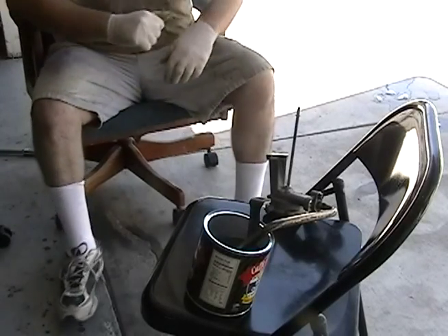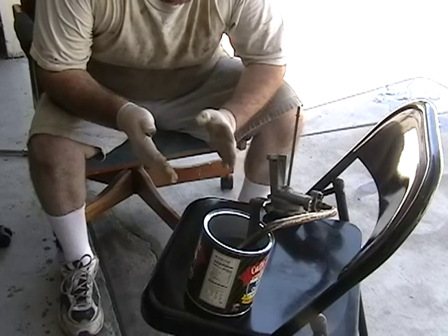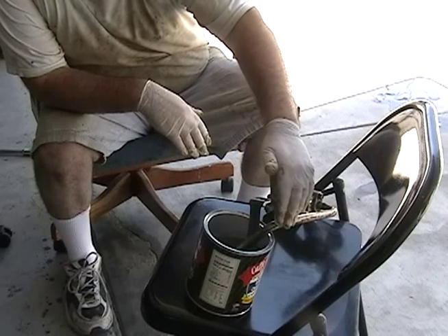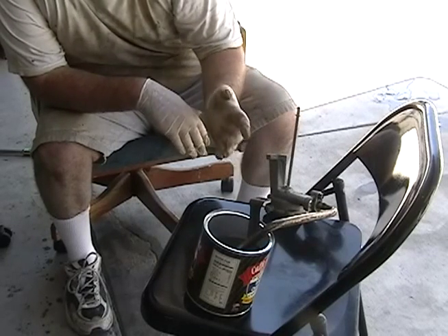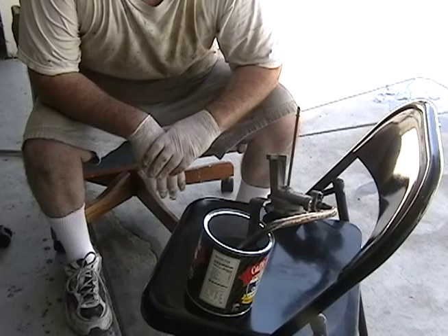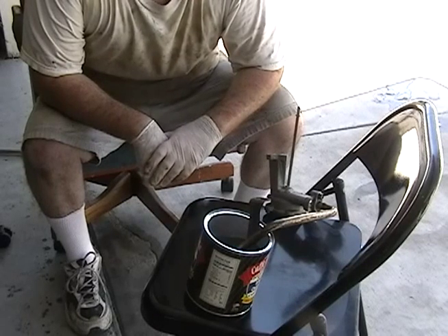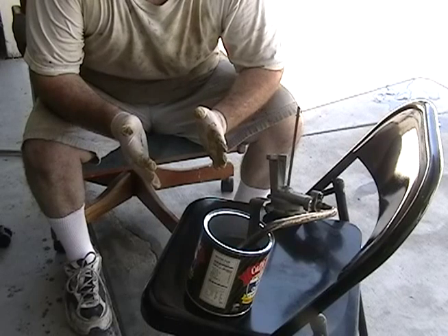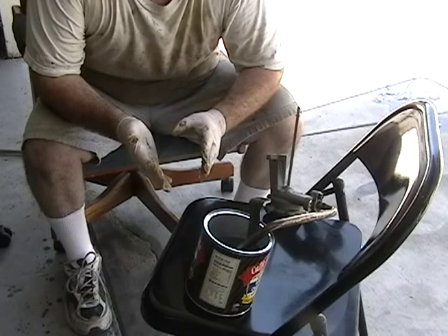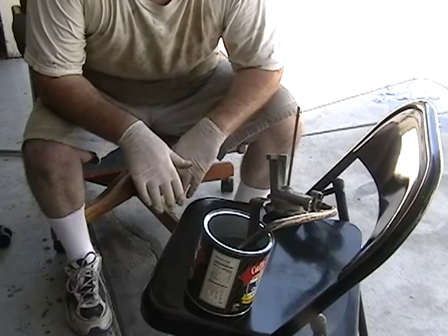I've taken off the pump for a second. I decided to use my existing pickup for the simple fact that it's much longer and it actually feeds from the bottom of the oil pan, not just the very top shallowing but deeper in. In my mind, if you were low on oil, the shallow area is going to be depleted before the deeper section.